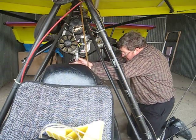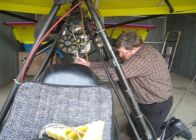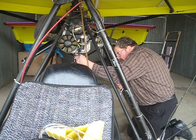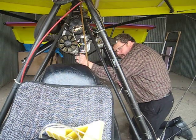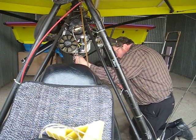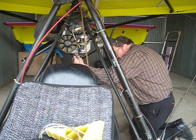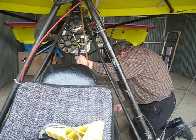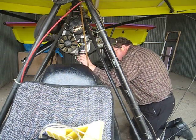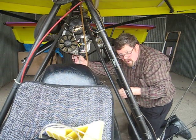By the way, I have safety wire on these. The reason is the prior owner had problems where occasionally his spark plug boots would fall off, so he learned to safety wire the boots to the engine. The problem with safety wire is it's stainless steel wire and the edges can be sharp — I managed to punch a hole in my thumb already. When putting new safety wire on the new plugs, I don't reuse the old safety wire and I don't even recommend it.